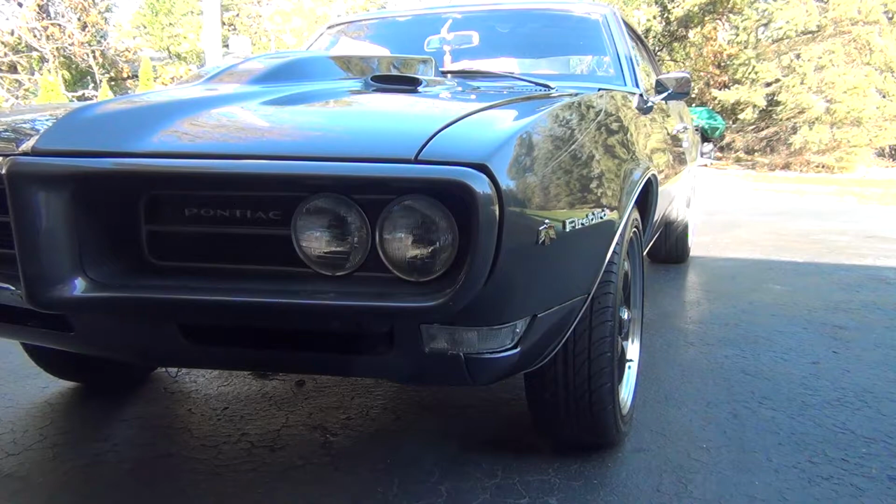Step 2, after we get the entire car clean, because we want to start with a clean car when we fire her up in the spring, we'll put Stable in the gas tank and fill the tank up all the way. I know that the leading cause of moisture in the gas tank is having air space sitting in there, and plus we don't want bad fuel sitting over the winter. That way, when we start her up in the spring, we're not starting with bad fuel. So we'll put Stable in the car, take it to the gas station, and fill it up. I have almost a full tank right now, so we should be okay putting the Stable in now. We shouldn't be ruining anything. Then we'll let that run through the system on our drive back to the house.